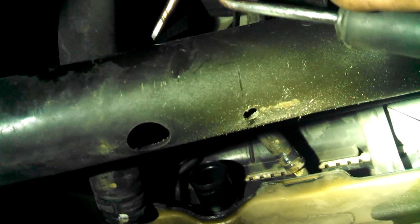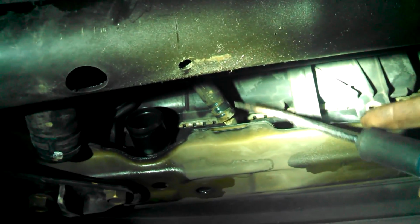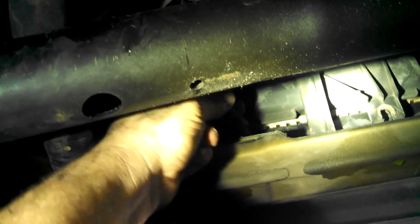Whoa. So you can see I've got the radiator hose off, just like I talked about. I used the pliers, went through this top part. Got these clamps loose, and these hook tools are really useful to try and separate the hose from the pipes. So I'll stick this in here, or if you get a small screwdriver, you can probably do that. Just separate those, and maybe you can twist them off. Twist and pull off. This one's free now, so just twist, so we can pull those off.